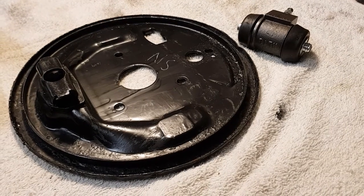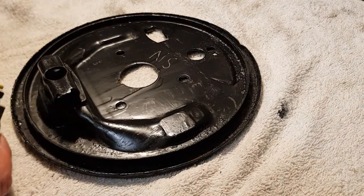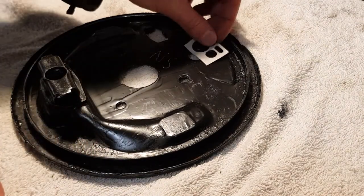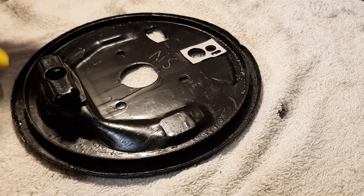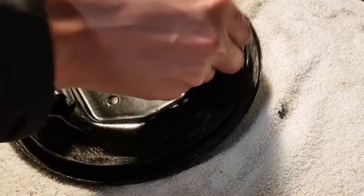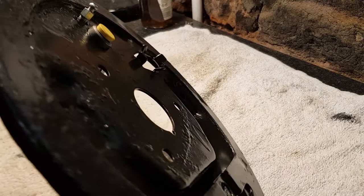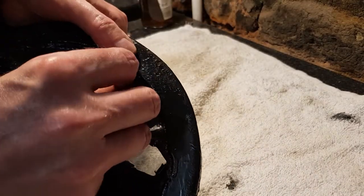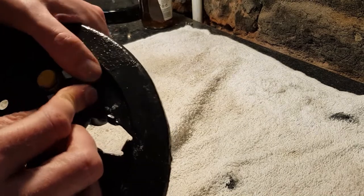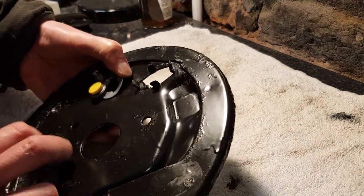While the drums are drying we'll assemble the backing plate. The first thing I want to do is put the wheel cylinder in — that's super easy to do. This little gasket goes on there, around that way. We then put the wheel cylinder through, and out the back it pops, and then there's a very small groove where this retaining clip needs pushing in. That should just slide in from the side, so I'll probably need to get to a better angle. I'll bring you back in a second once that's installed.